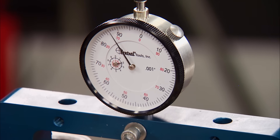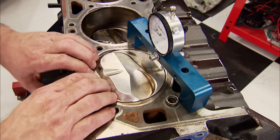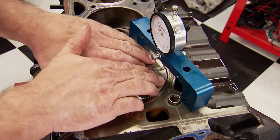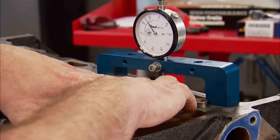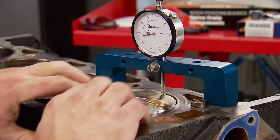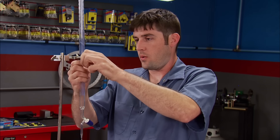When the dial reaches its stopping point, the piston is at its highest point, which is true TDC. Now we'll rock the piston in the bore and find the split between those two numbers measured at the edge. This is where the piston flats are level, and this will be the additional data needed for our formula, called deck height.